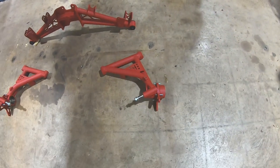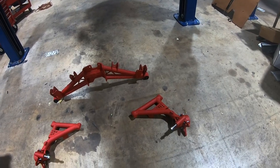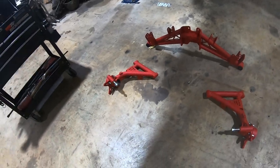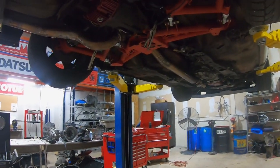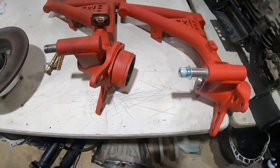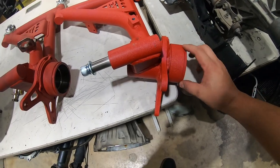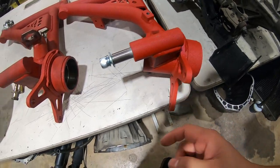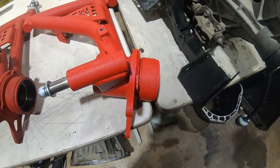The arms — these old ones were spaced too close towards the rotor. Once we get this all apart, I'm going to transfer my hubs and bearings over to the new one. Before I stuff it into the car, I'm going to clamp it in a vise without scratching it and check the brake clearance on everything to make sure it all fits properly before we start. I got the first version control arm out and the new one next to it. Right off the bat I can already tell we've got quite a bit more spacing. We measured it to be about a quarter of an inch off. The back spacing of this caliper mount is further back, like I told Ohm it needed to be.